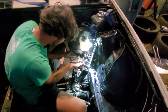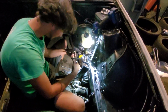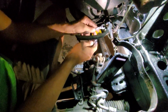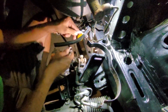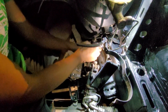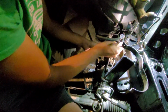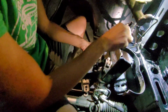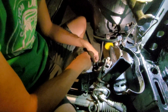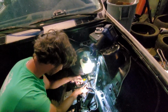This will work. I like how the brake lines don't go in square, but the science is there. They look square. This one is like... No, because that was right after a bend. Oh, that's true. Yeah, I had to bend it out to get the spool to work, and then bend it back. But I also don't want to go too tight, you know. That's probably plenty. Yeah, it's kind of in a bad spot, but when we do the fuel, we can put it back in the right spot. Yeah, and then this is ready to go, like here. That doesn't look terrible. Those are tight. Feels like a brake. Yeah, it's tight as I want to go with it.